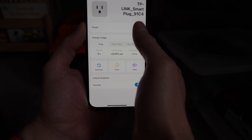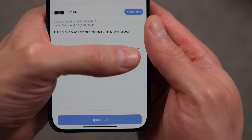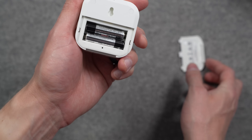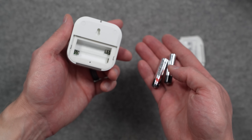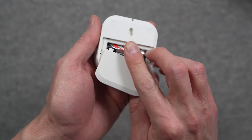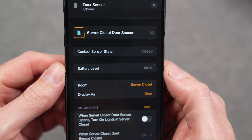The next thing you might have time to do in the moment is open the manufacturer's app and see if it can still communicate with the device, and also check for firmware updates — because if you're seeing flaky performance, it might already be fixed with a software update from the manufacturer. Lastly, if it's a battery-powered device, just check the battery. The Home app and other apps can report battery level, and if the device isn't responding at all, it's probably a good idea to replace the battery.